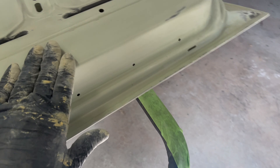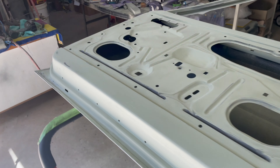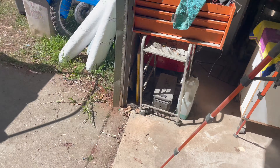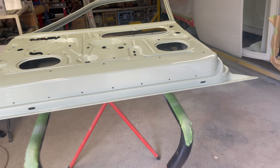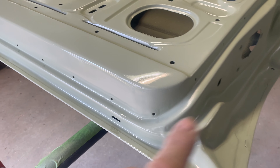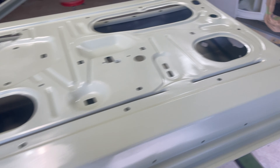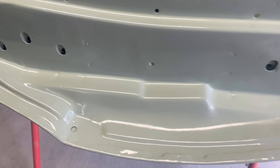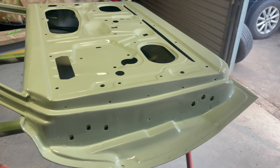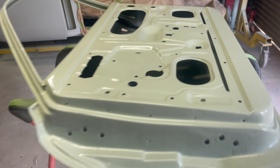Ready for a sand. This one — I just felt something there. It's got to be fixed. Anyway, I'm going to put some undercoat on in a minute — I'll spend another ten minutes on it and then undercoat it. Here it is: it's been sanded and I'll put the first coat of primer on. There was a little dent there which is fixed, and another one over there which is also fixed. Some little marks here which I also fixed. So it's all been sanded back. This door was a lot less work than the other door. This is an XW door.